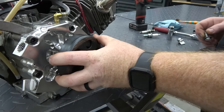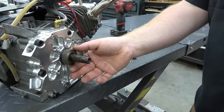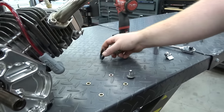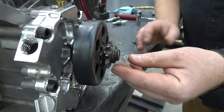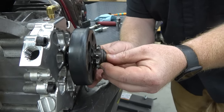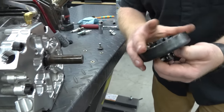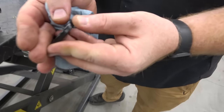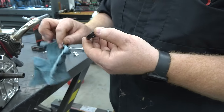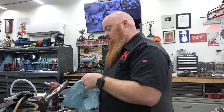One thing with clutches is you need room for them to float. He put a bearing on there just to space it for his particular build, and it worked out that a bearing was a good spacer. But look at his seal — it's completely not in there, they just popped that off — that's no bueno. If you tighten the clutch up and can't push the clutch side to side, that's incorrect. You need to leave enough so this clutch can move just a little bit side to side — it keeps stress out of the whole bell and helps extend the life of your clutch. His seal is in good shape. There's also a spring in there — that silver spring is what holds pressure on the bore. There's a lot of nastiness in there, so we'll clean that up.